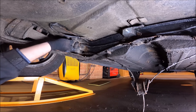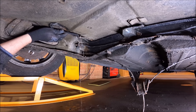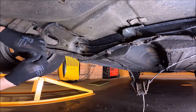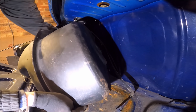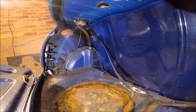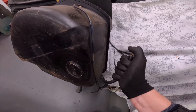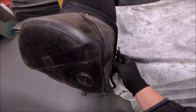I'll just start to get this clip off down the bottom here because it's going to be rusty. The clip isn't doing much - just capture any excess fuel leaking out of the hose. Now we've got the hose off, take the clip off the end, and now we should be able to pull the tank out and pull the hose through the hole in the floor at the same time. Just to be on the safe side, because mole grips left on for a long time could damage that hose, just wind a long bolt into the end to plug up the hole. If you can, tie it up or keep it above the level in the tank so it's not going to leak out.